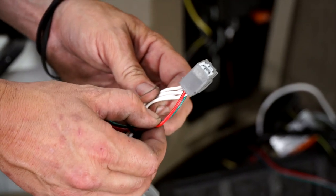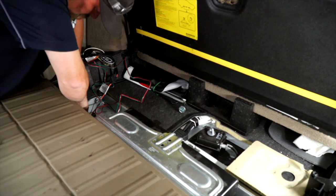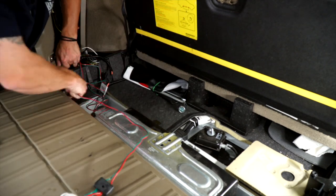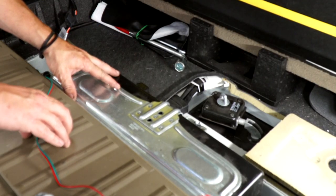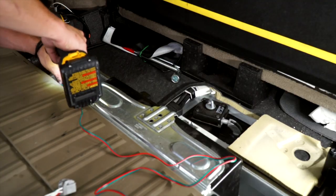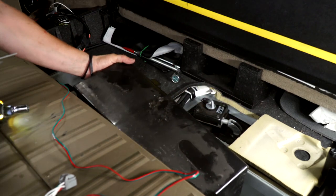So we're going to take the red and green wire and take it to the passenger side. To hide the wire better, I'm going to remove the battery housing so I can hide the wire back behind it, which is a 13 millimeter. You have a screw here, here, and here. You'll have a metal bracket that's on top and then a plastic battery shield — remove both those.